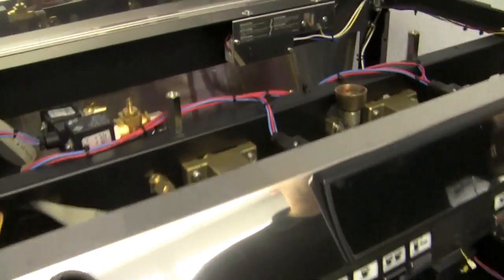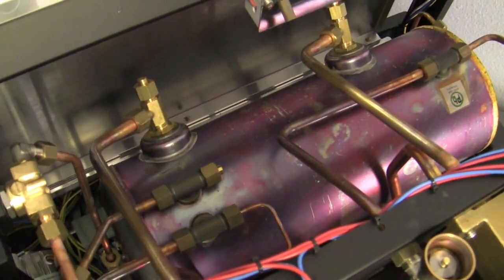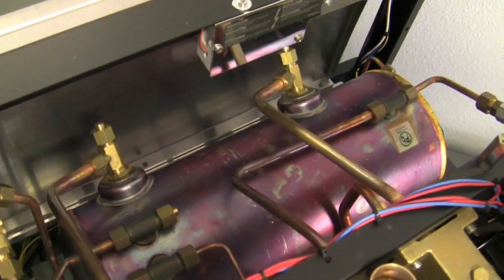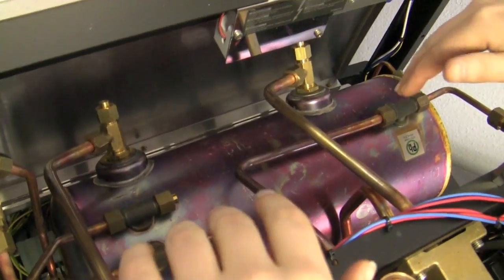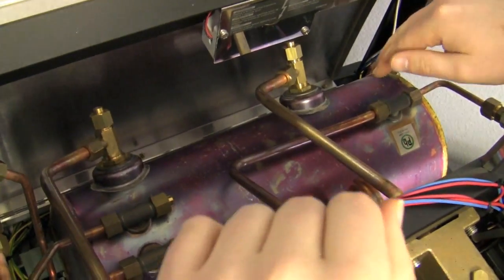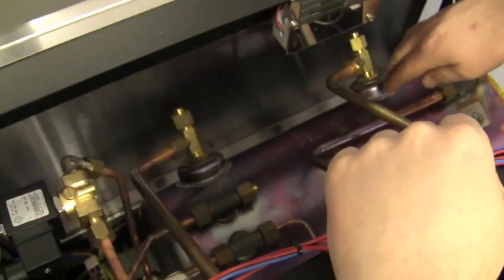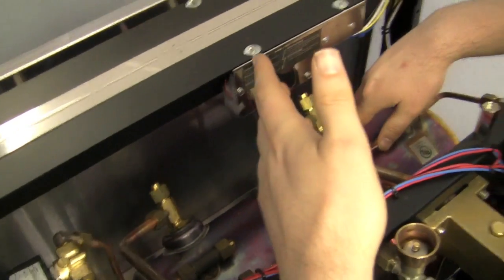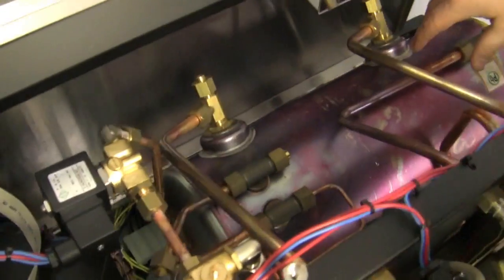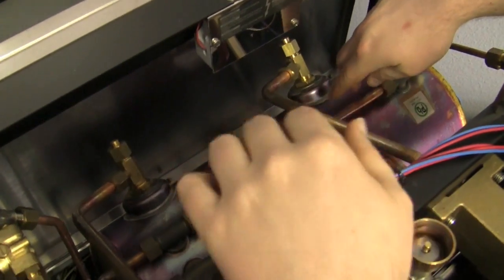Why don't you give me a little tour of all the components we have in here? There's a beautiful rainbow back there — it's quite pearlescent. That's my boiler. On any machine, you're going to have that gigantic boiler back there. I believe it's an 11-liter boiler on this machine. You see these big tubes coming out of it — these are what's called your heat exchangers. They're actually transiting through that full thing, through the boiler itself. This is your most important thing — it's what's keeping the machine hot, keeping your espresso hot, where everything is going.